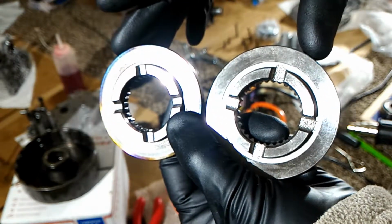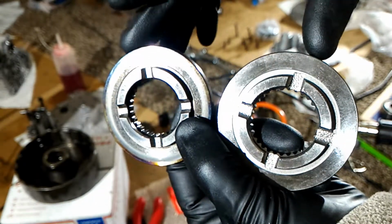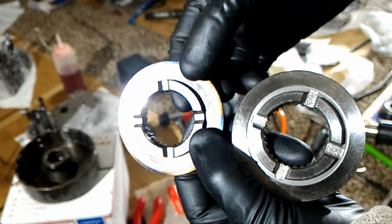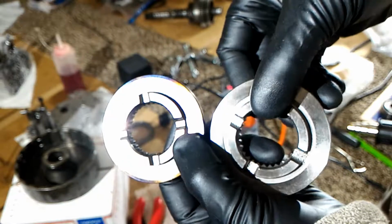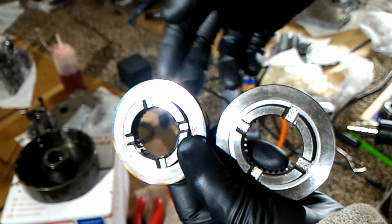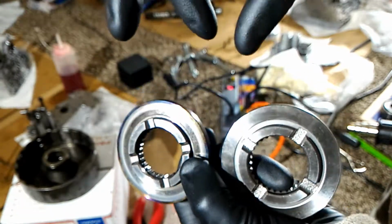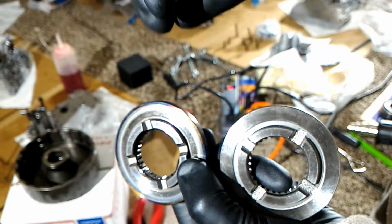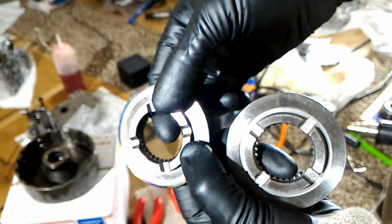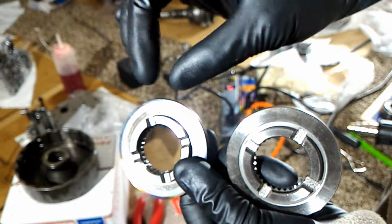And then I'm also gonna do the check on the latest software for the TCM transmission, or PCM, the powertrain control module. It controls the engine and transmission. I'm gonna figure out which one's the latest one, or which box part number or PCM part number is the latest one, because that one probably has the latest software. And then I'll try to get it programmed or updated at the dealership, because they're the only ones who can do it, because it has to match with your transponder key.